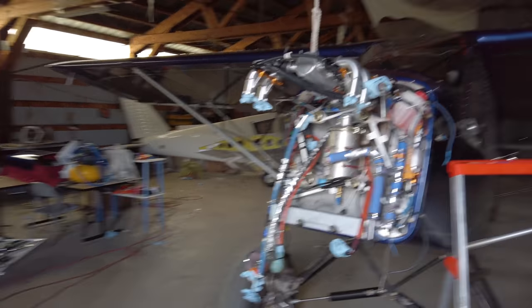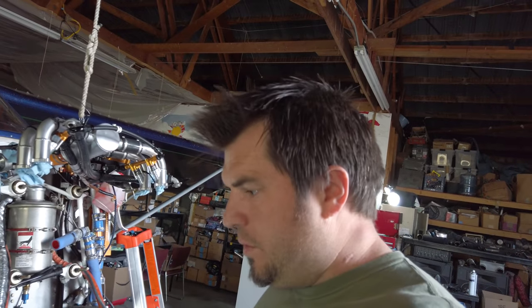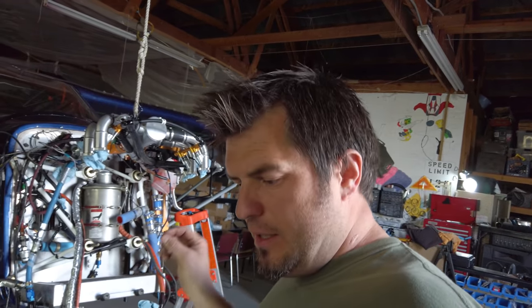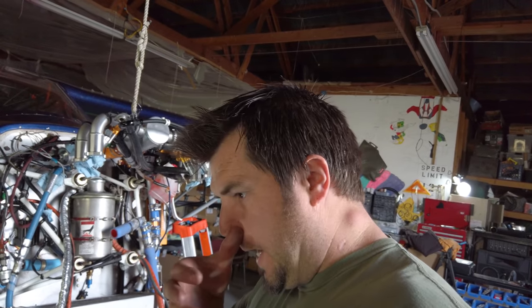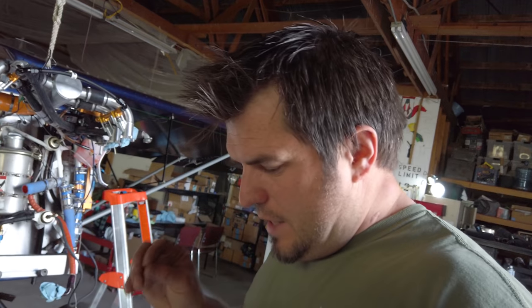Because really what'll happen is I'll be limited on power by not having an intercooler, or by how well this intercooler works. So this motor, I'll have the ULS pistons, so bigger bores, more displacement, and that bigger cam. Between the two of those, it would make the same power at a lot less boost, or it would make more power at the same boost, however you want to look at it. Now, it's not quite as good as it sounds intercooler-wise, because that turbo is still having to flow X amount of air to make X amount of power. It's just doing it at a lower boost setting.